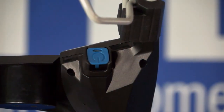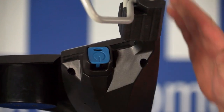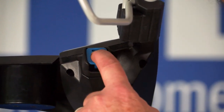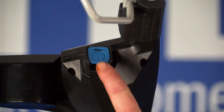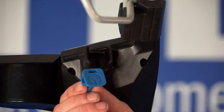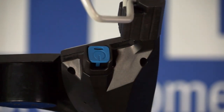The starter button is located here on your lawnmower. To engage the starter, simply push the button. When starting, you have your choke on if you need it, your handle back, and it will engage the starter. If you haven't pulled the OPC handle, it will not engage. Also note, this key is removable and you can put it on a keyring to keep it safe, to prevent unauthorised starting of your lawnmower. To replace it, simply pop it back in the hole and it's ready for use.